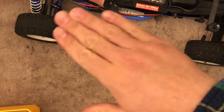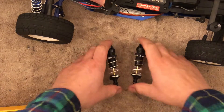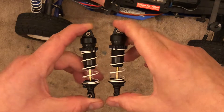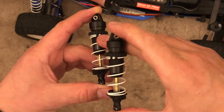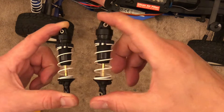But they were too stiff — the car would bounce on the front so it wasn't really dampening. I figured I'd show you what happens if your oil is too heavy for the spring. So these are the GTR long, double stripe black shocks. Again: 47.5 and 80 weight.